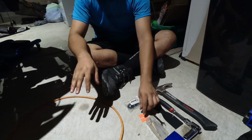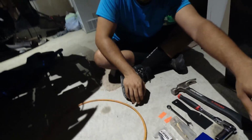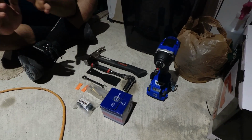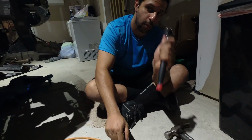After that, taking your oil pan off is very simple. You're going to use your impact driver with a 10 millimeter. Once again, you're going to be gentle with it. If you're scared to take things off with an impact driver, a 3/8 ratchet with a 10 millimeter socket works wonders.